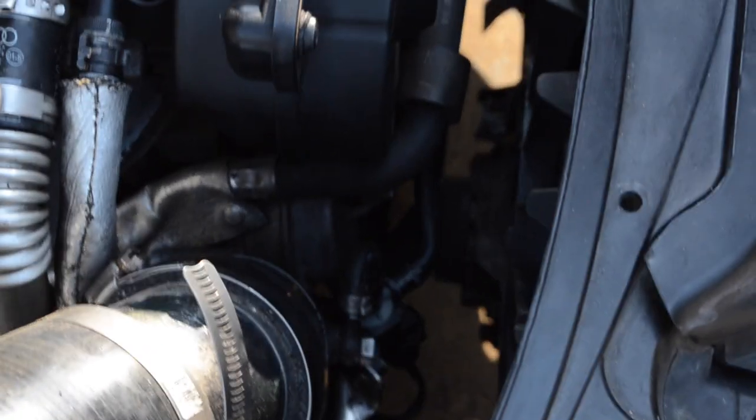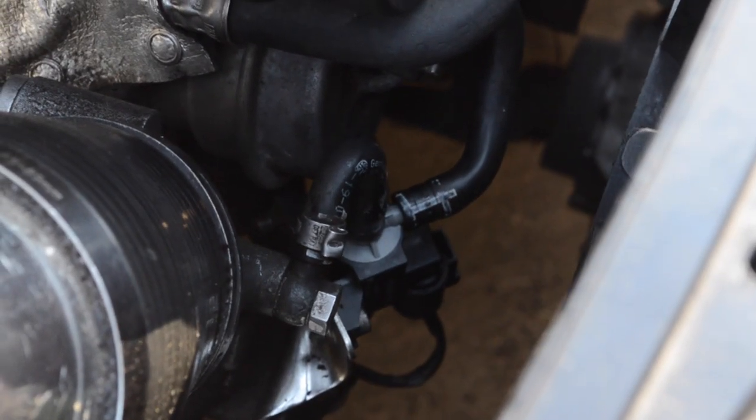We're here with Tito. Actually, he ordered the clutch switch, but another car part got here. My turbo's been acting up a bit, and my code came out for N75. I ordered the clutch switch, but the N75 came in earlier than the clutch switch. That N75 valve is literally right by your cold air intake and your turbo setup over here. There it is.